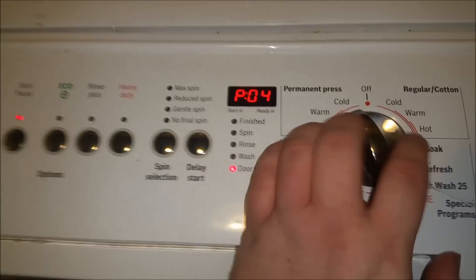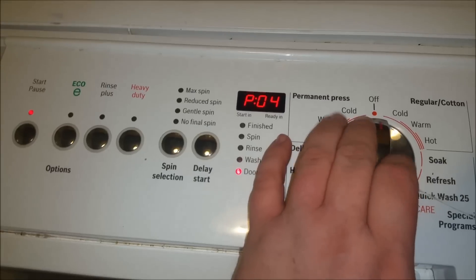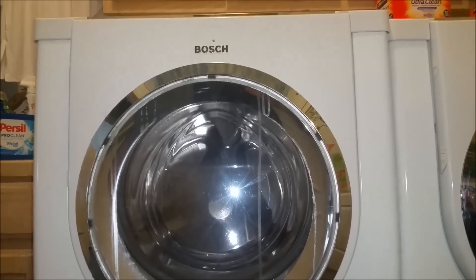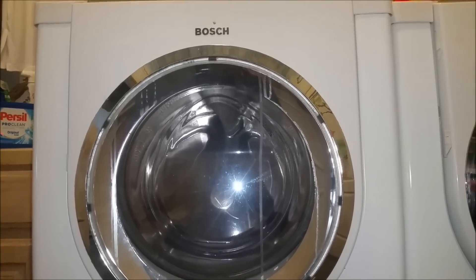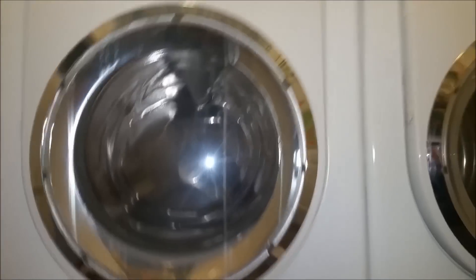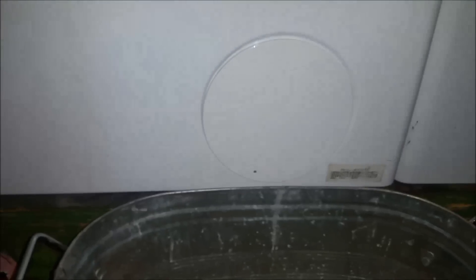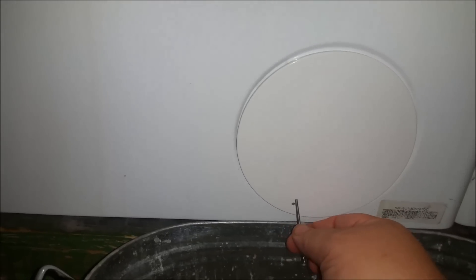To stop the diagnostic cycle, just switch to off. We're back. I forgot to say the customer complained of an E-13 error and the door wouldn't open — that's what it is with this Bosch front load. Now here is where you get to see it — it's the front of it, little right-hand corner. Here's the drain cleanout. What you're going to do is take something like a paperclip and stick it in that hole.